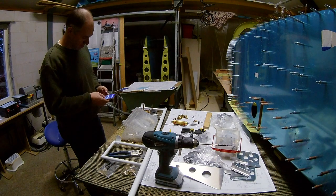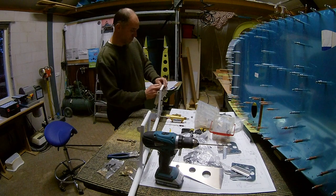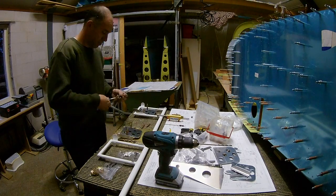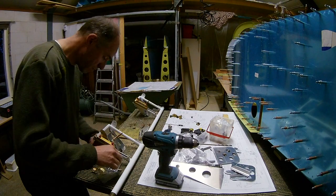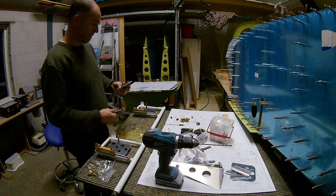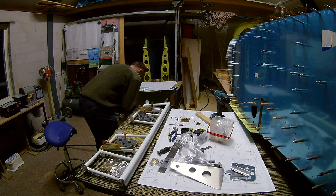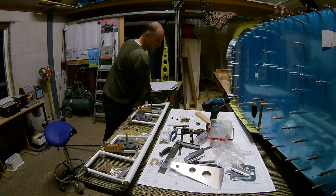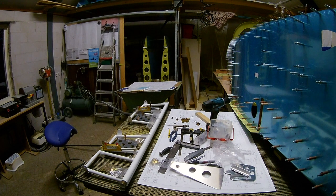You have to install the brake cylinders yourself, and I'm not sure yet how they should be positioned. I was trying to figure out the hole that needs to be drilled through the pedal and the brake cylinder, but it didn't feel right so I haven't drilled it yet. I'm going to visit a fellow RV-7 or RV-8 owner and take some pictures there. You can see here that the left pedal is positioned a little bit forward and the right one a little bit backward, so the angles are different. I'm afraid I'll screw it up, so I want to get some reference photos first.